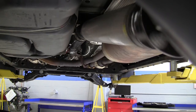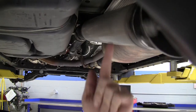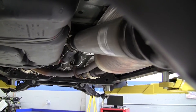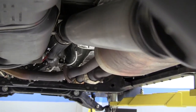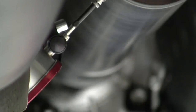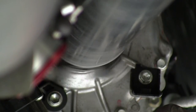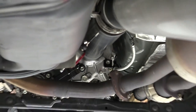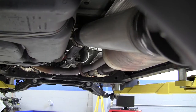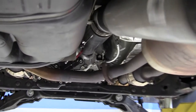This is a two-piece propeller shaft. The first piece at the back of the truck is aluminum and it goes up to a center support bearing where it changes to a steel propeller shaft, then continues up to the back of the transfer case. We are going to measure runout in several locations on both the steel and aluminum propeller shafts, starting at the front on the steel propeller shaft.